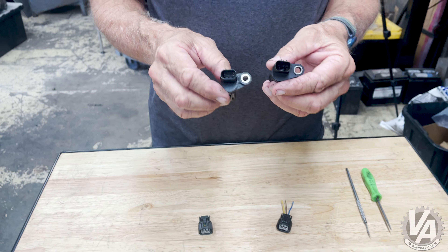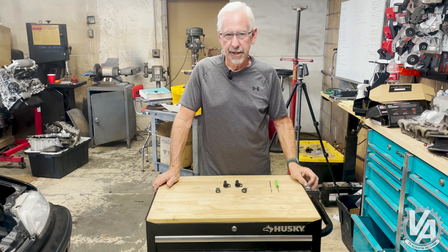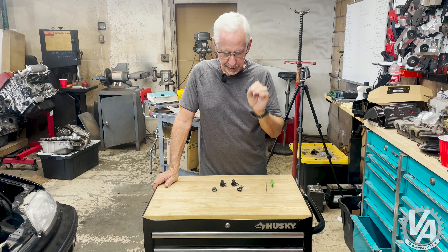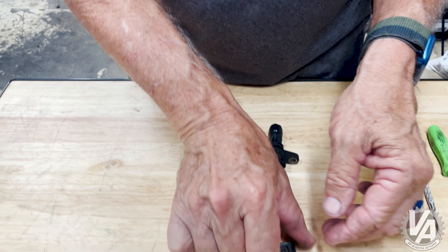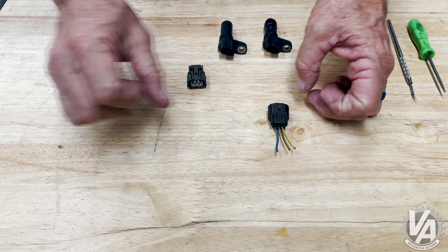When you use a different connector, it also requires you to wire them differently. The wiring is not particularly difficult — I'll show you how to do it in just a second — but it is critical that you have it wired properly for the connector you have. If you have the one with the centered keys, it's wired: blue, brown-yellow, yellow-black.